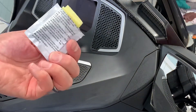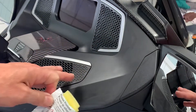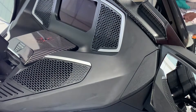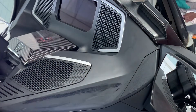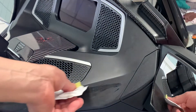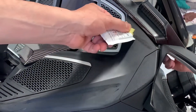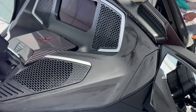We're always providing the adhesion promoter. This is a surface area where you would want to use that — you're going to wipe it on that surface. This is basically insurance that you don't have peeling issues. We've went ahead and applied the adhesion promoter in the area where the dash kit's going to be installed. This ensures that the product's going to stay in place for years to come. You want to wipe that surface area.